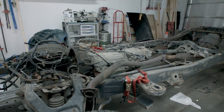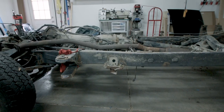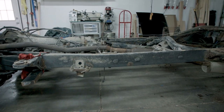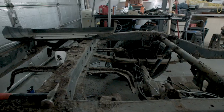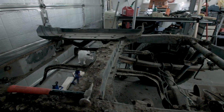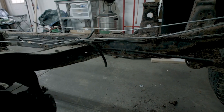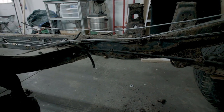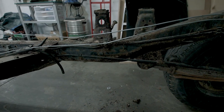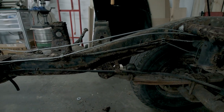I think the best way to describe it is as I was expecting it to be. There's a little rust here and there in a couple of the joints where pieces of metal meet and were welded. Spare tire holder basically should not exist anymore. That was rusted. The cross member along the back is rusted as well. The big thing is the rear corner on the passenger side, basically from the rear cab mount about 3 feet backwards is just gone. Then that's where the farmer's patch is.